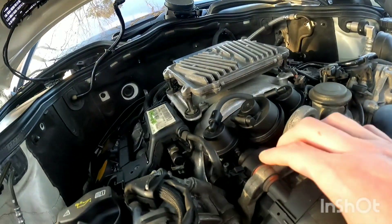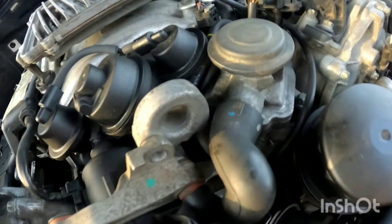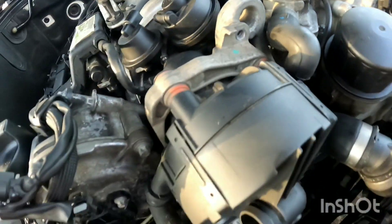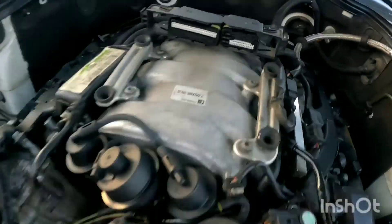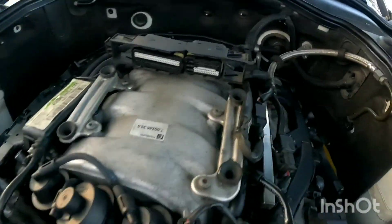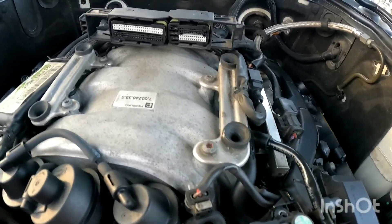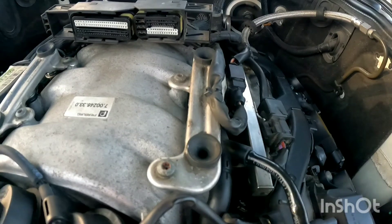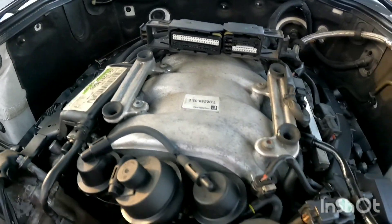That should let us take the bracket off from the back side. For the ECU removal, we just unplugged it from the back — it has clips and slides on. You pull these pieces out to the side and it basically just pops right off. You might have to reuse these brackets on your intake, or your intake could come with them depending on the price you spent.